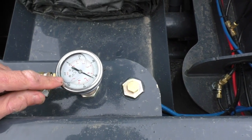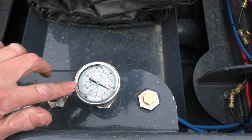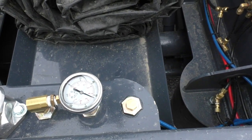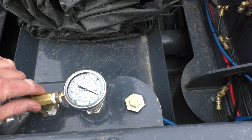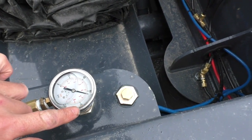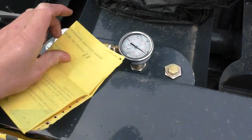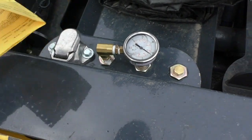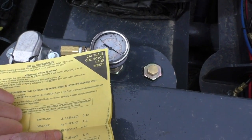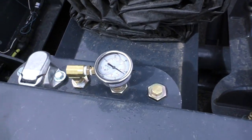They also gave me this little gauge, which is pretty handy — it shows PSI, so it's pressure not pounds, but I know that 60 on the track when it's at the fifth wheel is pretty close to basically 20,000 or under 20,000 per axle. Now I'm at 57 — so when it's 70 or like 65, that's what it shows. It does help to have this. Wait — 53,000 on all three axles, so basically you deduct about 10. We'll figure it out.